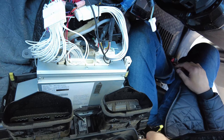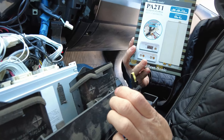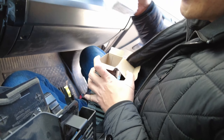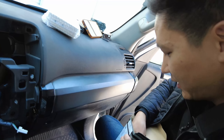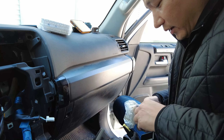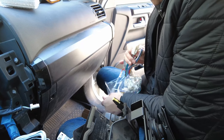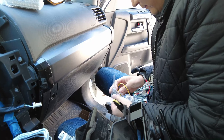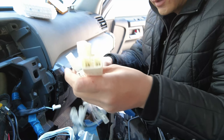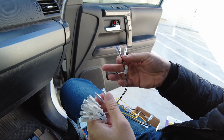Once we get down here, we're going to install our Micro Power Amp. Inside you'll find the actual amplifier and our plug-and-play harness. Let me get this harness ready for the install. They actually use connectors made in Japan — sweet. There are going to be a lot of bullet connectors on here. We don't want to cross the wires, so we're going to match the colors.